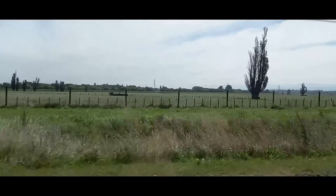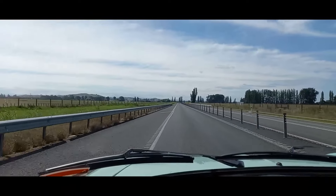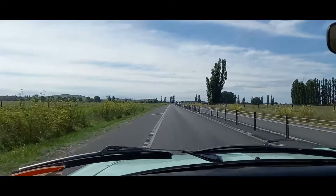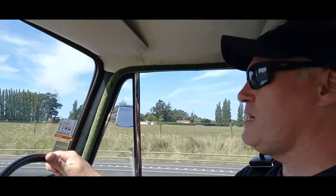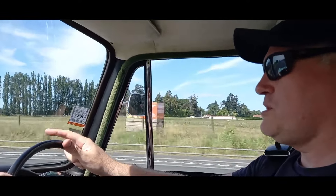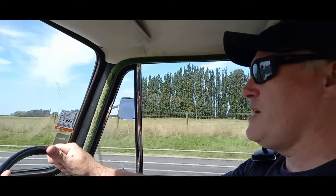Given that it's quite a hot day today, it's running at normal temperature. On a really hot day you wouldn't want to be driving this car in built-up traffic, stopping and starting, because the water temperature just climbs and it only has a manual fan — the engine would just overheat.